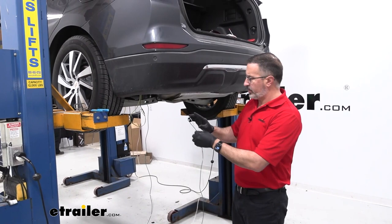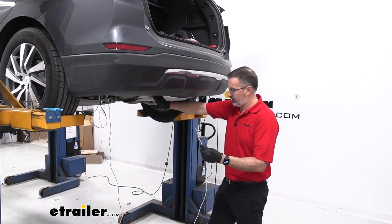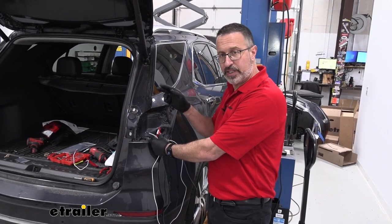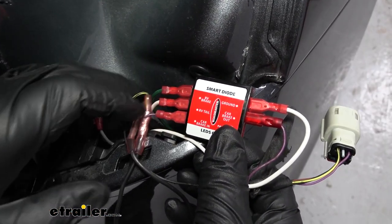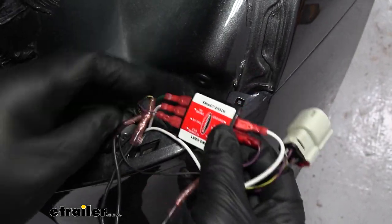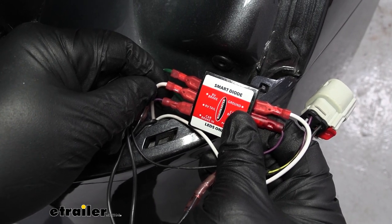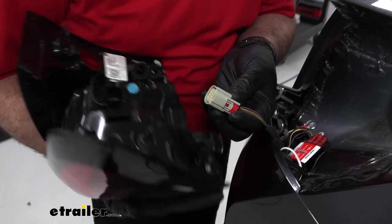With our connections made, I'm going to run our two wires up over the bumper beam and over to the other side — we have a hot muffler here that we want to avoid. We've got our wires fished up through the hole and we're going to peel back the tape from the factory so we can get our connection points and repeat everything we did on the other side. We pinned it out the same way — we turned on the tail lights and over here on the passenger side, that's going to be the purple circuit for the tail lights going into the car brake in, and then the car brake out goes to your connector. The green wire is the RV brake and the brown wire is the RV tail lights — we used the extra wire from our four-way flat and tied into the brown wire. The only thing left to do is to reinstall the tail lights.